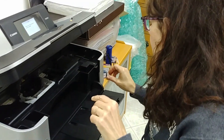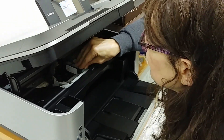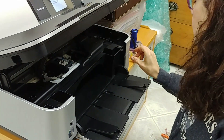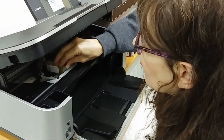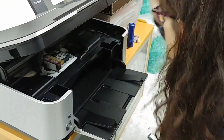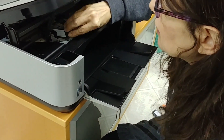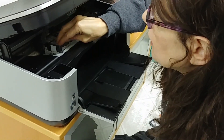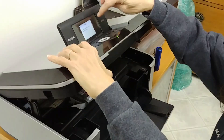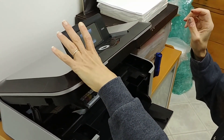Now we're going to put this in again — it's the same one that just failed. I've taken these cartridges in and out about five thousand times at this point. All right — magenta and they're all fine, you can see that they have ink in them. You don't want any dry cartridges. The gray bar snaps down, we're done. This was in at the end of a cycle so I'm going to power it off.